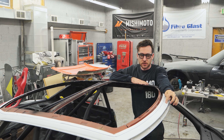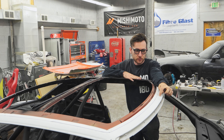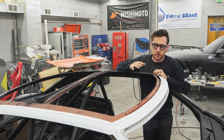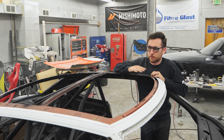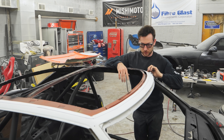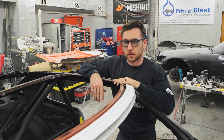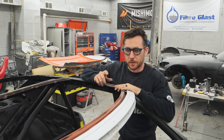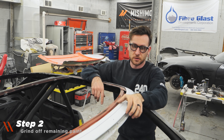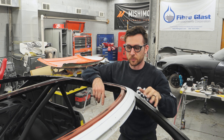When I was sanding the roof flat, I actually screwed it down in a couple places. Since the outside of the roof is going to be painted and not bare carbon, running little screws to hold it is a good way to get it exactly flat without needing like 30 clamps. So what I'm going to do right now is grind down this edge of the metal that we're actually going to bond to and get all the paint off of it.